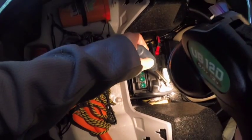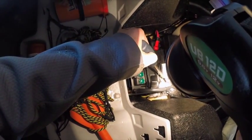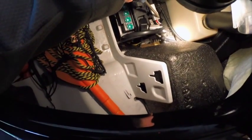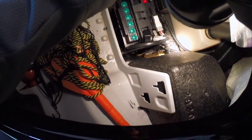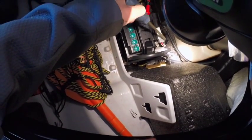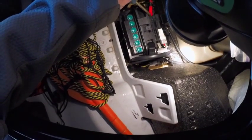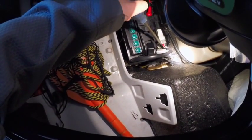The next thing you're going to do is unhook the battery. Take this off first to get access to the negative terminal, then unplug it by pushing down here. Then take off the positive. Always remove the negative first, then the positive. When putting it back on, it's positive first, negative last.